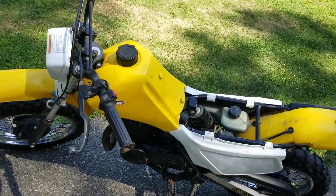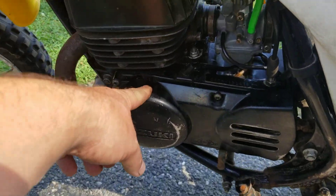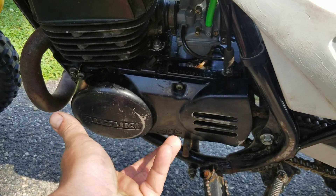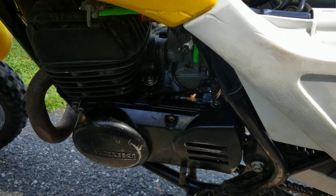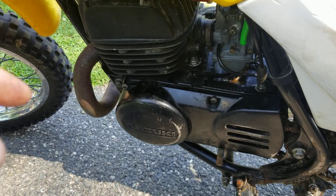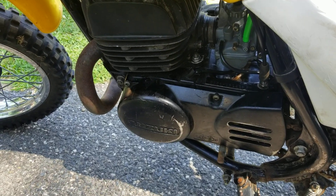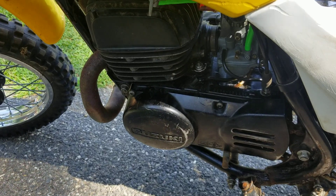To find that out, I took this cover off right here. You can do this on all your bikes — your KEs, your KMs, all those. Take this cover off, grab your flywheel and rotate it. You might be able to feel a grittiness, almost like it's turning on sandpaper. Let's get you guys in closer — I'm gonna get this thing fired up. But before I do, please hit that subscribe button and the bell icon so when I post a video you guys get it.